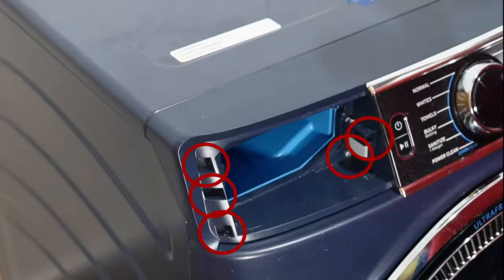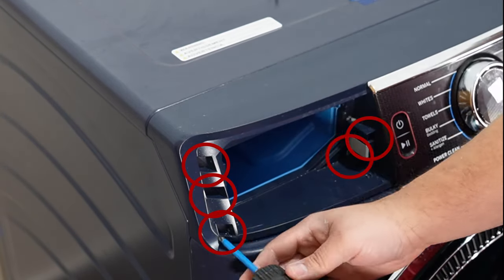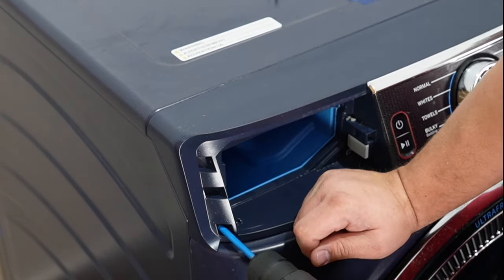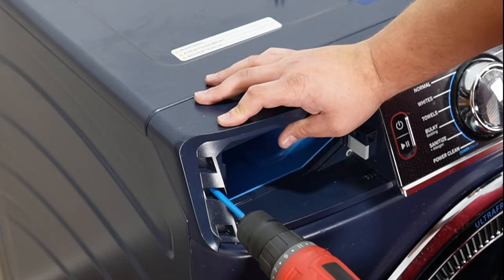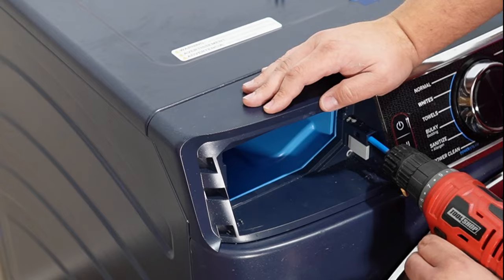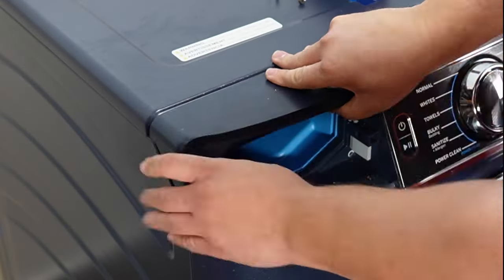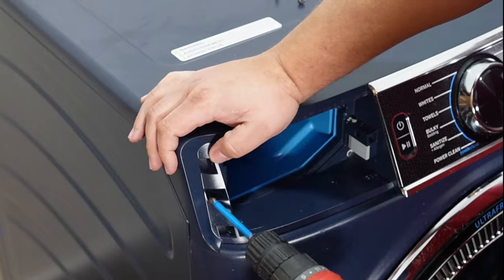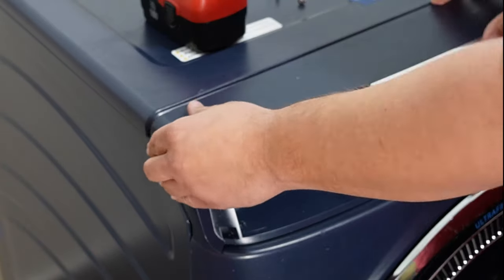Each of these need removed, preferably with a magnetic tipped screwdriver, because one of the most problematic things I encountered with this initial part was that the 2 middle screws on left and right have a very bad habit of re-threading back into the dispenser housing. You'll either need to use a dental pick or pull forward on the housing to force and remove the screws. They need to fully vacate from the housing before disassembly.